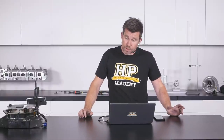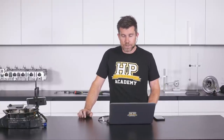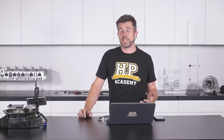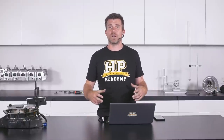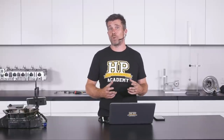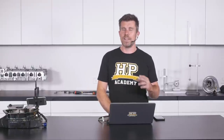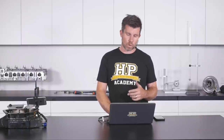Oliver asks: thoughts on increasing oil capacity via an oil cooler? Adding an oil cooler does increase total oil capacity by some amount, which isn't a bad thing. However, it doesn't achieve the same aim as a winged sump — the winged sump in conjunction with baffles and trap doors keeps oil around the pickup, something extra oil volume in a cooler won't address.